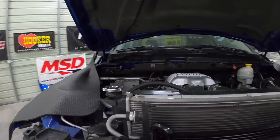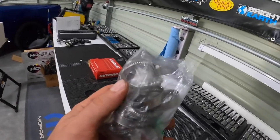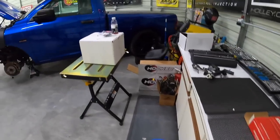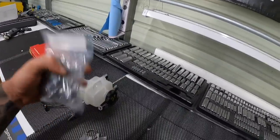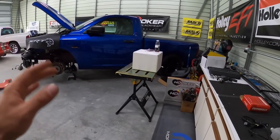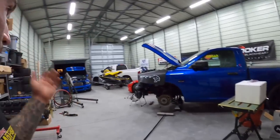Brackets are drying out in the sun. While they're out I'm going to work on some hoses. Our clamps showed up for the heater hoses — I like to use a premium smooth-banded stainless steel clamp rather than a serrated worm gear clamp, so they don't bite into silicone hoses. They come in exact sizes so you don't get the big overlap tab. Going to throw those on the heater hoses.